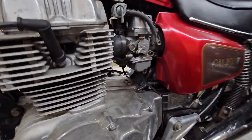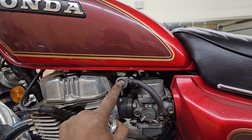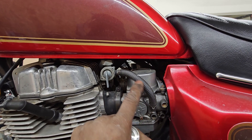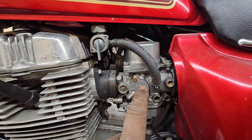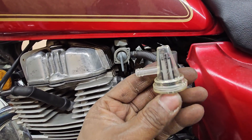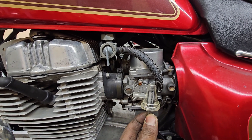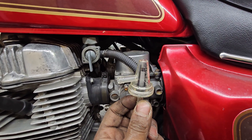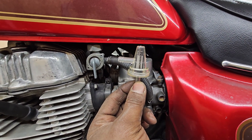One last thing — gas tank, petcock, carburetor. This is the hose that feeds fuel from the gas tank to the carburetor. You should have a fuel filter in here, because if there's any schmutz in the gas tank and it passes through, it's just going to go into your carburetor and make for a very miserable day. So I will introduce to you a fuel filter — this is Faralas — essentially goes right in line between the petcock and the carburetor. It'll probably sit somewhere around there and filter the fuel before it gets into the carburetor and potentially causes an issue. This little guy has a directional flow arrow — stick it in there and you'll be right as rain.